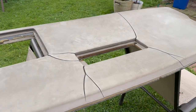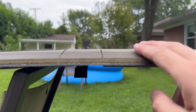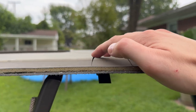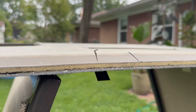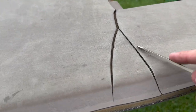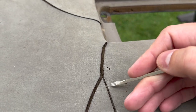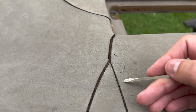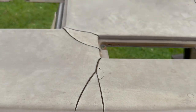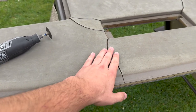Next up, we're going to want to get this surface nice and flat, because right now the material kind of bows up where the crack is. So even if we covered it, we'd see these weird ridges left in it where the material's folded up. From what I was reading online, you should be able to just kind of cut it, get your cutter in there. But this stuff is so old and brittle, before it cut, all it did was crack. So I'm going to do a little unorthodox method here — take the old Dremel with the cutoff wheel and just zip a couple of lines on the outside, peel it out, and then we'll get ready to fill in with our dash pad filler.